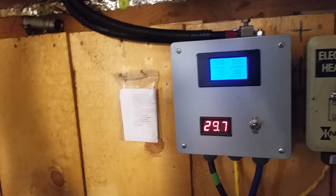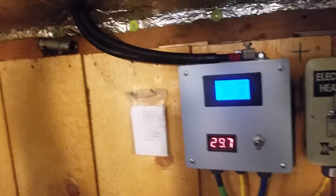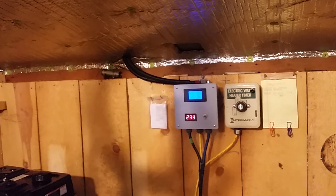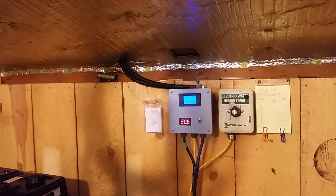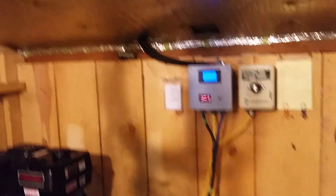All I have to do is connect that sense wire to the sense wire on an alternator with an internal voltage regulator capable of sensing the voltage on the battery bank. That extra 2-volt drop from cable resistance means you're really going to be working this alternator hard. I need at least a 130-amp commercial-rated alternator. The one I picked out is capable of 80% of its power output at 3,000 RPM, so you don't have to turn it very fast.